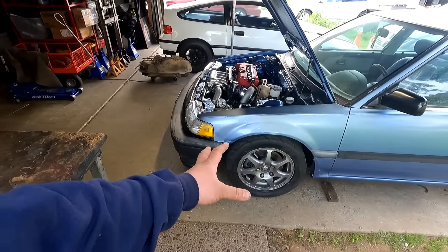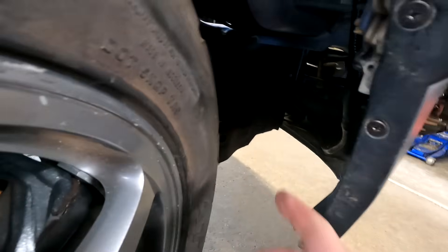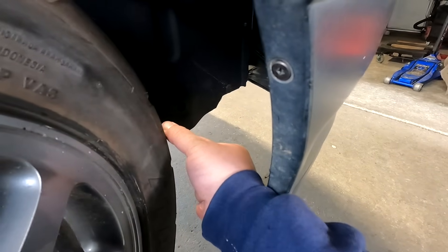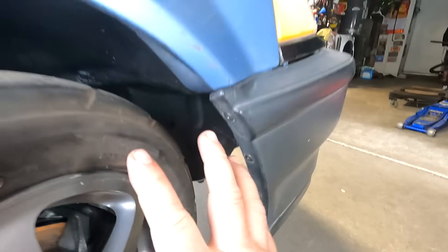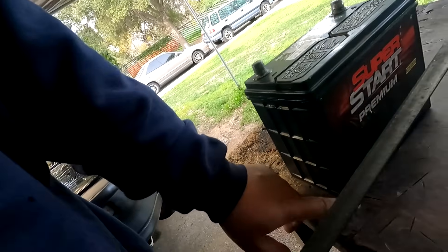We have the car jacked up and I did test fit the battery yesterday — it does fit here. Between the tire and the battery I have maybe a thumb-size gap, and once the wheel is straight we have like an inch and a half, which is plenty. The goal is to make a fast street car on street tires, so I'm not worried about the minimal gap. I'm just going to build the battery tray — the part the battery is going to sit on.